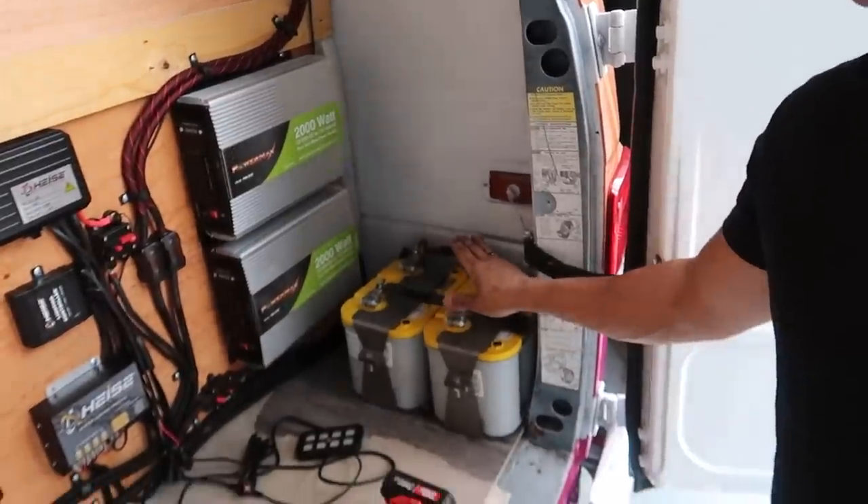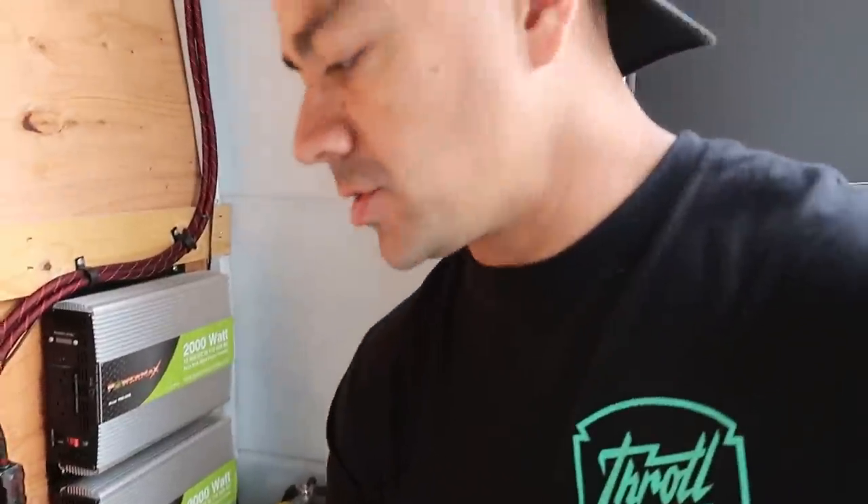I'm in the back of the ice cream truck with Big Jeff. We have the two batteries back here and I want to add a battery charger — these are four-amp chargers — and keep it back here ready to go while we're sitting at events. The truck is going to be off and we'll be running the generator and the batteries to support all the electronics. We're going to run only the two rear batteries plus the generator for everything, and cut the switch off to the front battery to save it just for the engine. I'm going to mount the charger to the wall and run the wires to the battery.